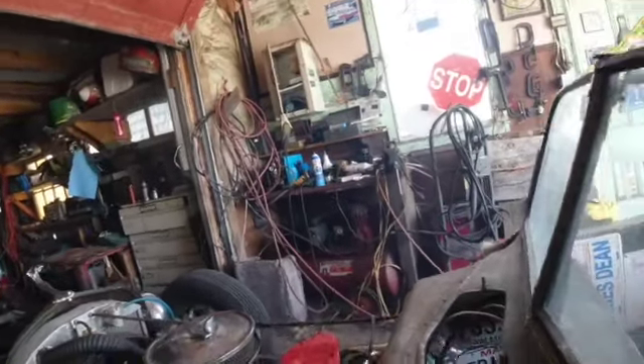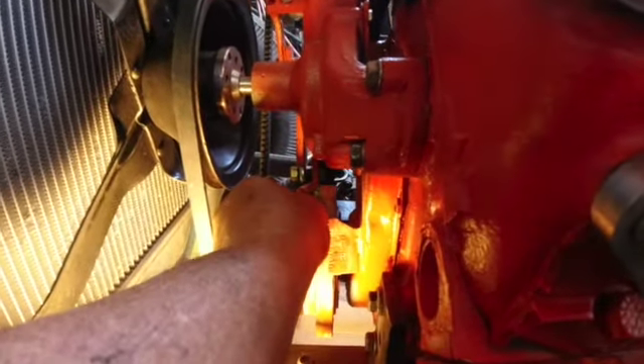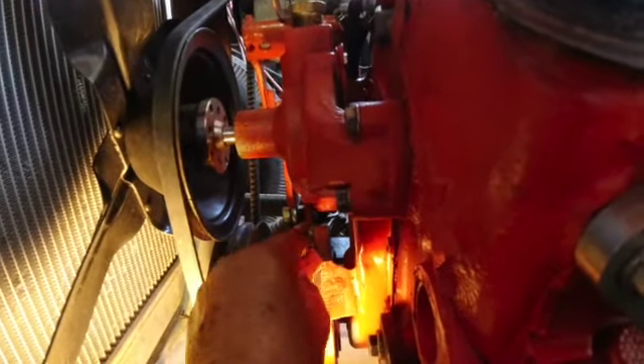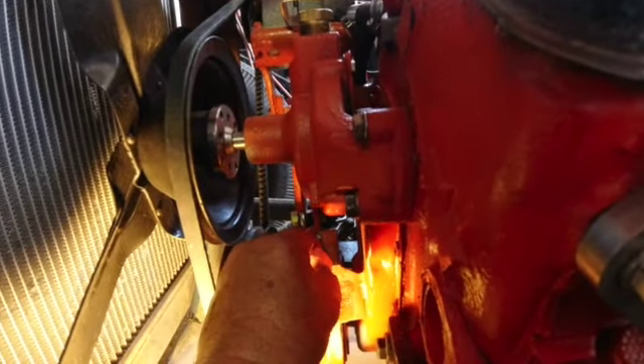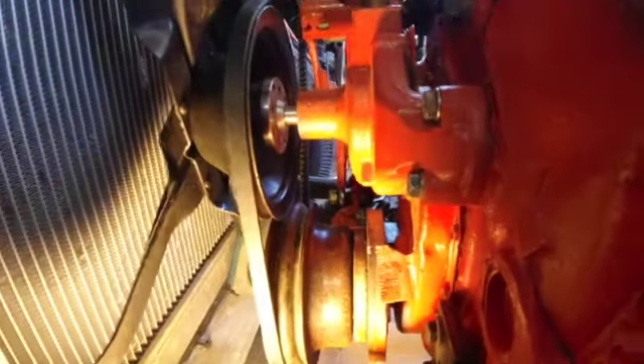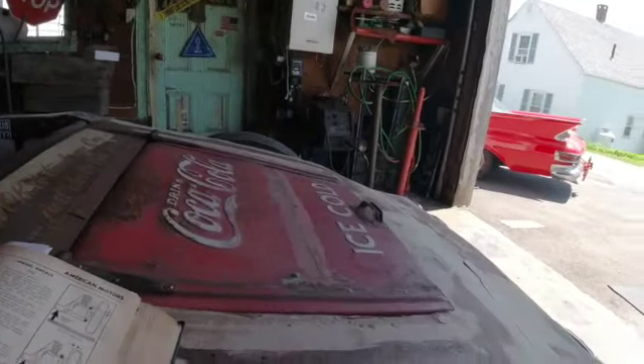I'll cut the motor off and I'll come back to that. There's the timing mark right there. See that little notch right here? All I'm going to do is take this piece of chalk and put a little chalk mark right there. Now this is top dead center right here where the zero is, and my book will probably tell me what standard timing is. Usually it's so many degrees before top dead center.